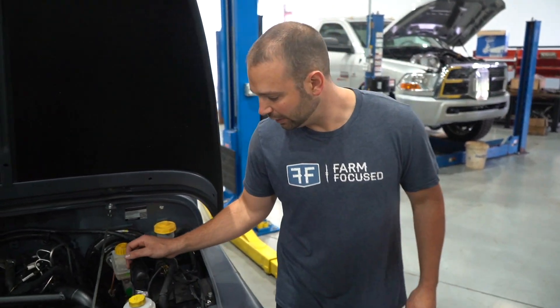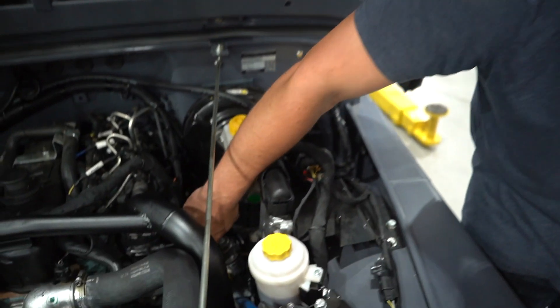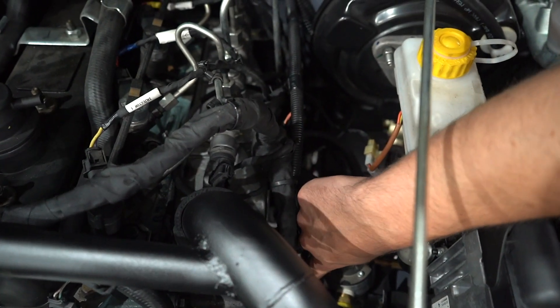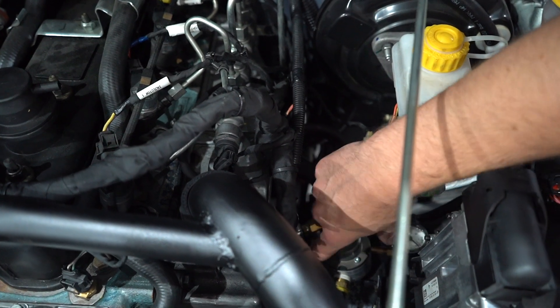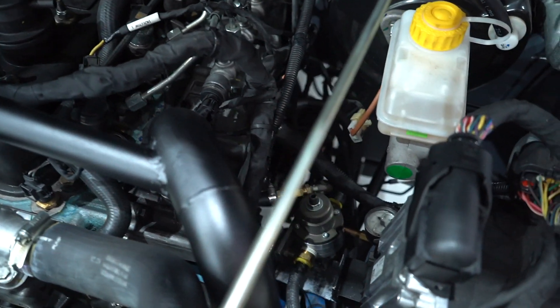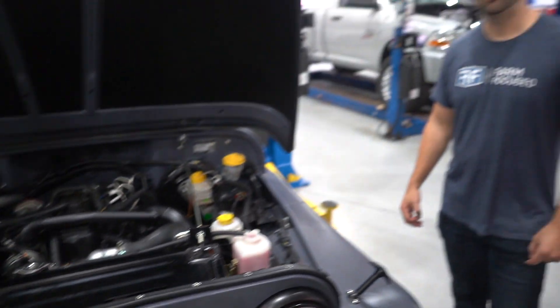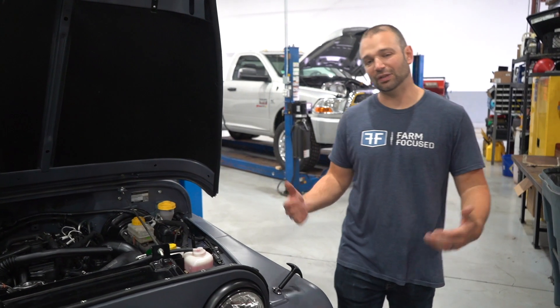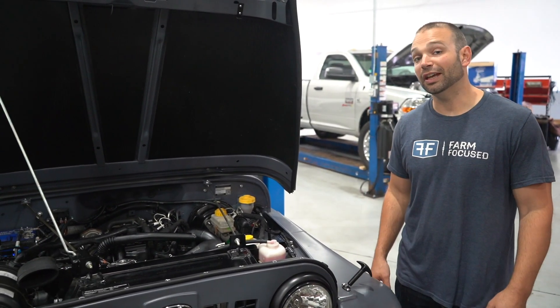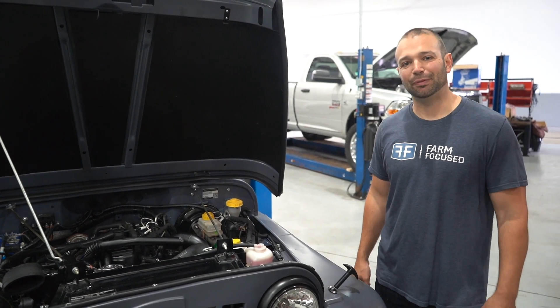Come around here, I'll show you one more thing that we did. You can kind of peek in here at this fuel pump. This is not a stock fuel pump — this is a CP3 pump, and here's a fuel pressure regulator. We've added that CP3 pump, which gives us a lot more volume of fuel and allows us to turn the tune up even higher. To go past that 120 horsepower, we need more fuel. With the CP3 pump, we've got 400 horsepower worth of fuel. Of course, we're not using that yet, but we have it on tap if we need it.